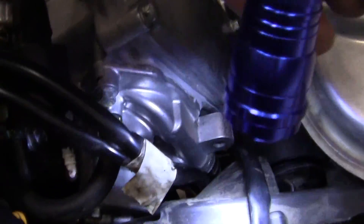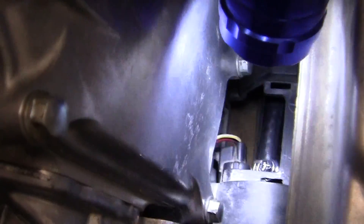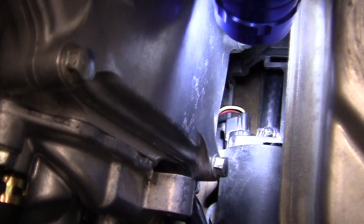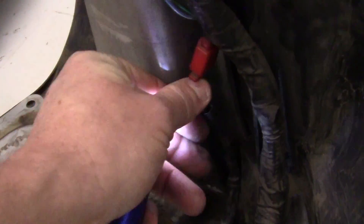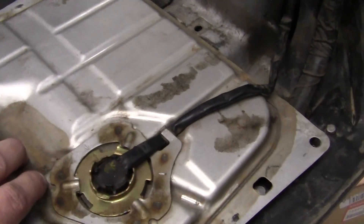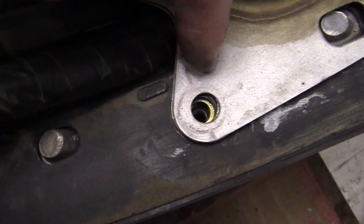The last thing we need to hook up is the fuel pump power line, which goes right next to the push-on connector near the intake from the gas tank. Then we hook up the fuel sensor that tells if you're high or low on fuel. Pull the gas tank over like this — you want to make sure your little copper plates in here are lined up; they slide onto the frame.